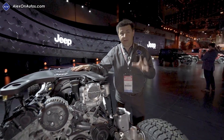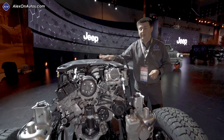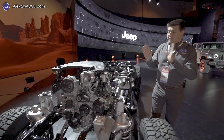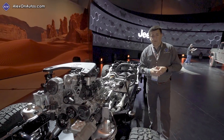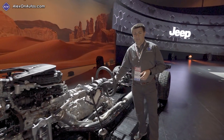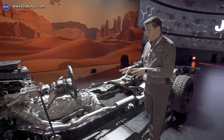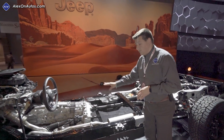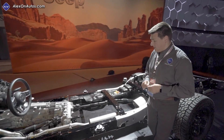The engine remains the same — it is a 3.6-liter naturally aspirated V6 gasoline engine. The Mojave cannot have the diesel engine; the main reason for that is weight, as this is the lighter engine option. We have just one transfer case option as well. Since the purpose of this vehicle is not to rock crawl, we don't have the Rubicon transfer case ratio; instead, we get the same transfer case ratio found in the Sahara.